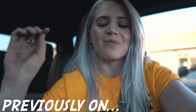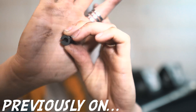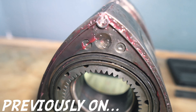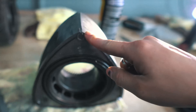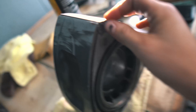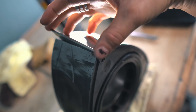I am starting the rebuild process for my 13B for the Party FC today. Today is the day we are stacking the 13B for the Party FC. We've been working on getting that rotor that was messed up in the last video — all the seals needed to fit. It wasn't actually the slots that were that bad, it was the corner seals. We've all been filing corner seals for the past three hours, but finally the corner seals were too tight and they're all filed out now, so the messed up rotor now is great.